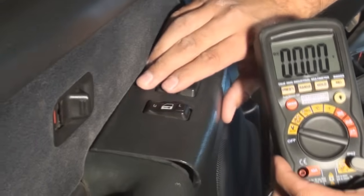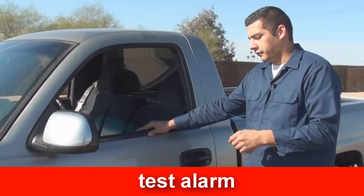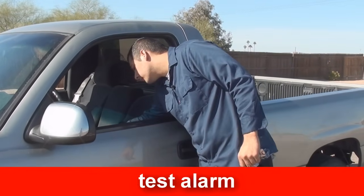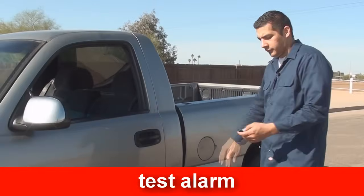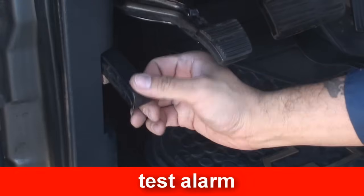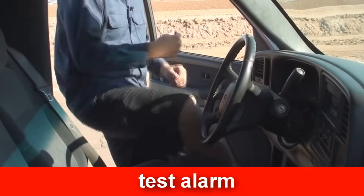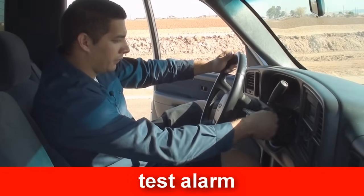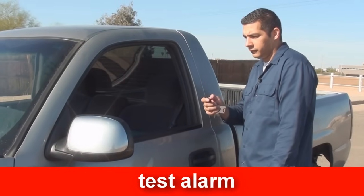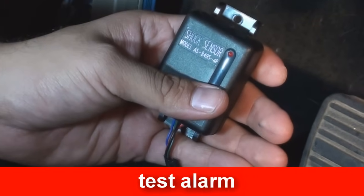After all wires have been integrated, test the alarm functions. Close all the doors but leave the windows open. Arm the alarm and wait 20 seconds for the unit to arm. Reach in and open the door through the window — the siren or horn should sound. Do this for each door. If you have the hood and trunk monitored, arm the vehicle and pop the hood release cable from inside and open the hood; it should go off. Once the hood, trunk, and doors are tested, arm the vehicle, get in and try to start the car with the key — it should not start. To test the shock sensor, hit the base of the steering wheel; the shock sensor should go off. If not, you may need to adjust the gains a little bit higher. Well that wraps it up for the alarm install video. Thanks for watching.